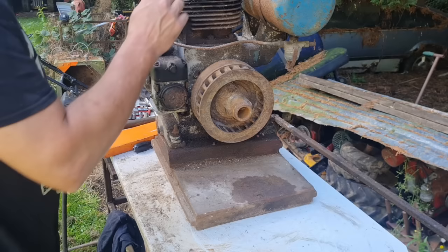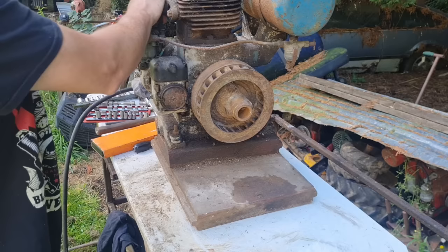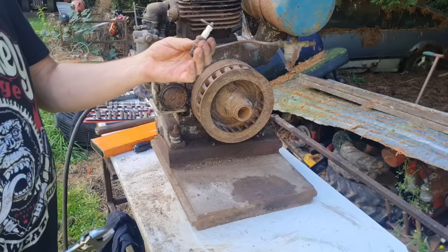There we go. Will this plug come out here? Sure. Oh, Jesus, she was tight, but steel plug and aluminium head, look. Another 30 years, you wouldn't have got that out of there. Whatever plug have I put in there? She's a long reach, but she's a champion N5.